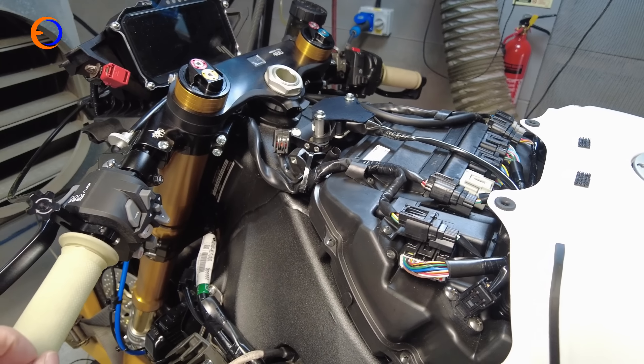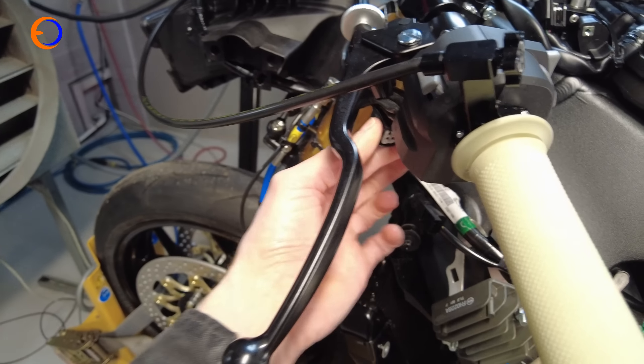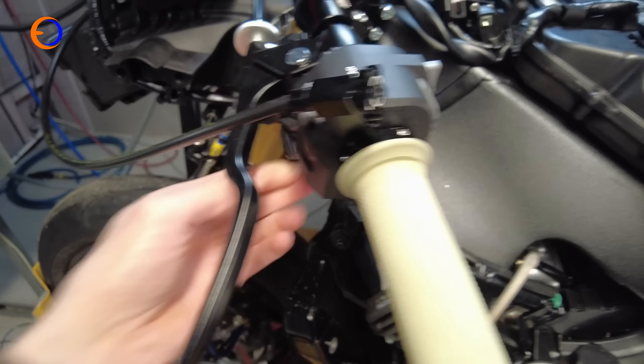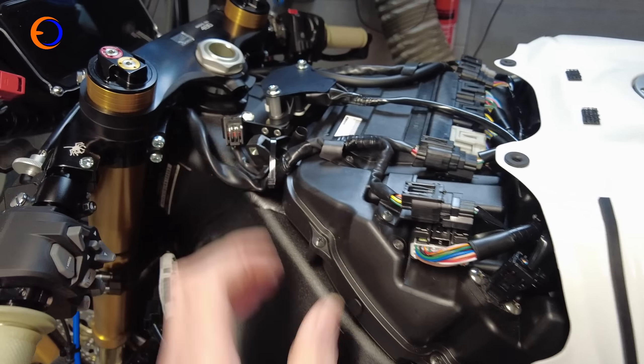Welcome back to Obsession Engineering at Honda Racing in Louth, and Harry is just prepping us for the dyno. Just before I loaded the bike into the van yesterday, I realised that the left-hand switchgear wasn't doing anything. You could press all the buttons you wanted and nothing happened, so I did a bit of head scratching. There's a plug down here that isn't connected to anything, and I kept looking and there is absolutely nothing in the kit loom for it to attach to.